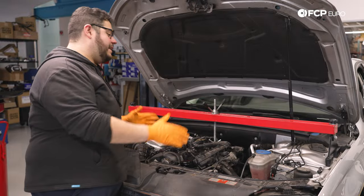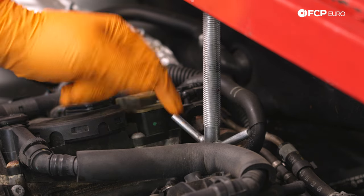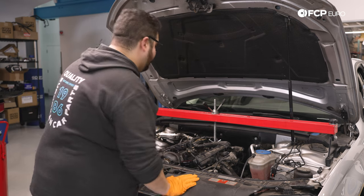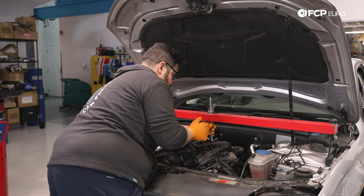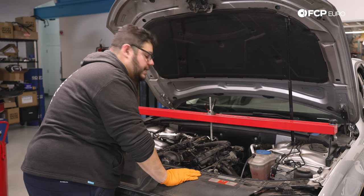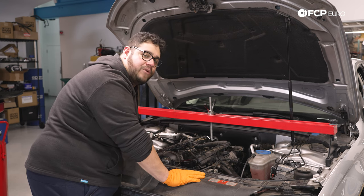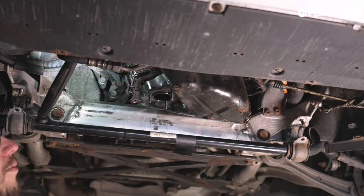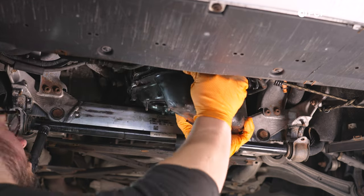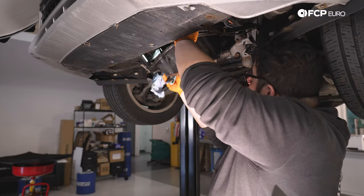We're back up top in the engine bay of the A4. We have our brace set up on the stiffest parts of the strut tower. We're going to get this to hook up onto our bracket and just get a couple of millimeters up — that'll give us all the room we need to get our oil pan out. We got a couple of turns there. Our goal is not to rip the engine mounts, just simply to stretch them out a little bit. Let's hop back underneath the A4 and wiggle that pan out. We are back underneath, engine supported up. We threw in one bolt just so the oil pan wouldn't fall out in case this is enough room, which I think it's going to be.